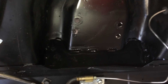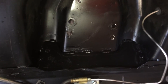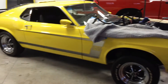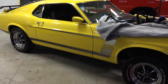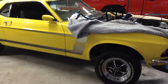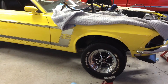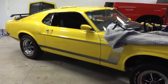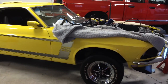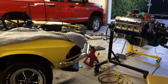The plate's been painted and the new holes have been drilled, so now we can reinstall the front suspension. This concludes the upper control arm geometry change drop and the outer shock tower reinforcement install. Thanks for watching, hope that helps, and stay tuned for more. We still have to install the stroker motor.